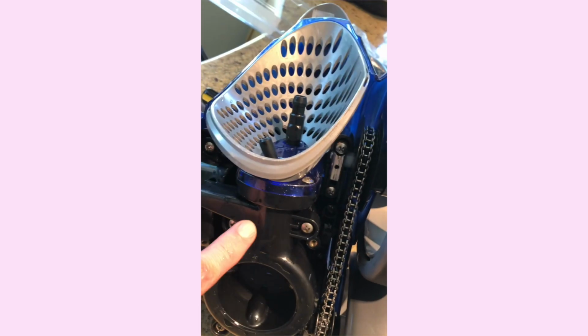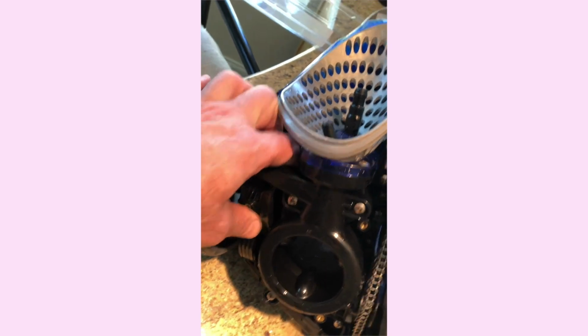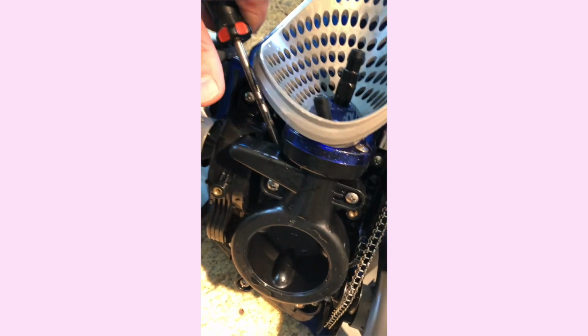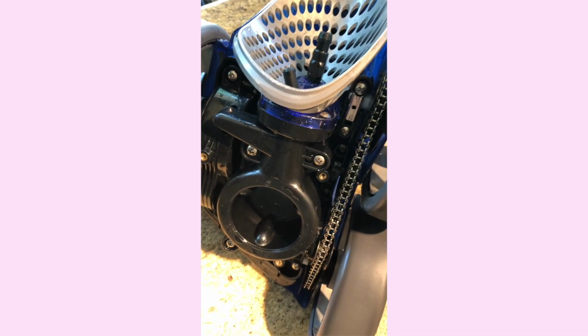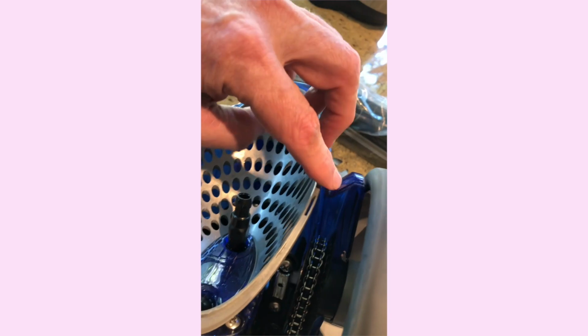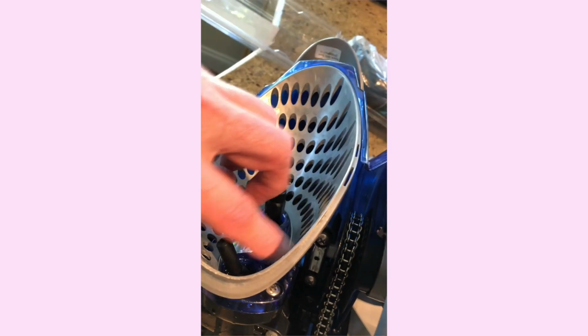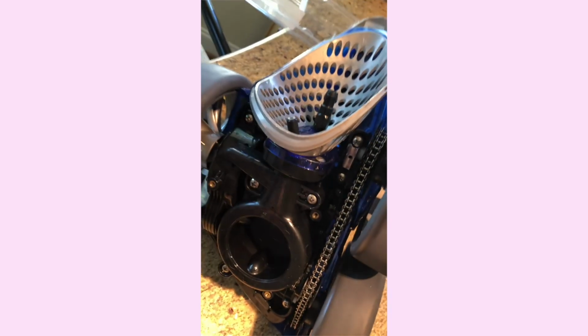It's where the water comes into the unit, basically, and that O-ring is very tight, and so you have to pull hard enough. Usually what you got to do is get your screwdriver in here and pry a bit to get that O-ring to pull out of there, to at least loosen it up enough that you can pull the whole thing. The other thing is that this gray piece somewhat separates easily. This might look like it's holding it, but it's not, or there's not enough pressure here when you've got the pressure you need to pull this thing up.